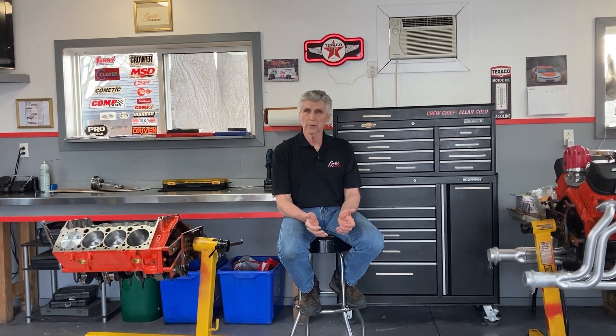Another point: once an engine leaves my dyno, I have no control over what happens to it next. People who manage their own engines can set the timing back, run rich fuel-air mixtures, keep the engine cool, and manage how they drive it. But once I turn an engine over to a customer, I don't have any control over that, and I worry about every single one of them. I'm sticking to my 160–180 psi. Going back to the original question — can you run an L88 427 on pump gas? — I really think you could if you're careful and do all the things I mentioned.